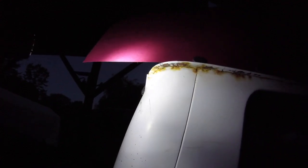Like I said, the bus is 63 inches wide back here in the tail bed area. So with this gate shut, my pipe is going to have to go where these two bolts are inside that and then come straight up. So you can see I got quite a bit of overcalculation here. And so what I will do in that case is come straight up from this point. And so really the only place that we will overhang the cab is right here. So about 4 inches, probably 3 inches on each side needs to come off, and then that angle up top will have to be recalculated again. But that's the plan. And then same thing on this side.